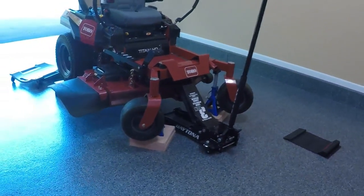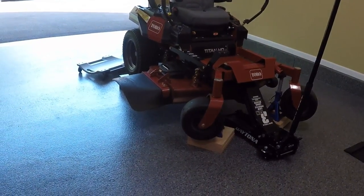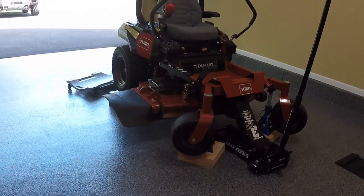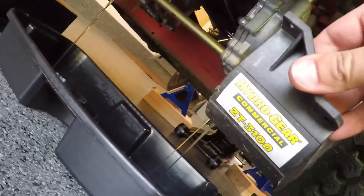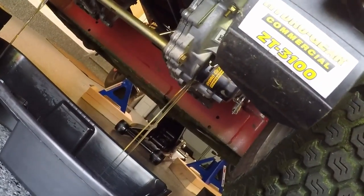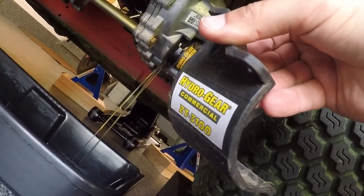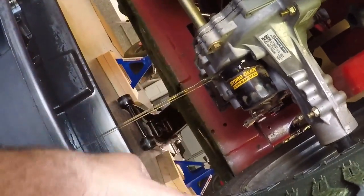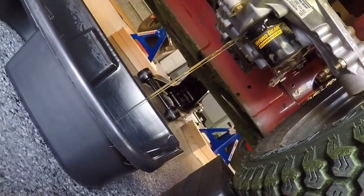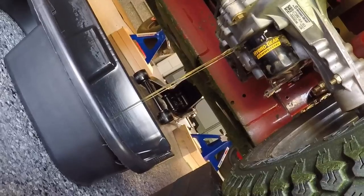Consult the owner's manual before you purchase or order anything, just to make sure you have the right one. These filters fit most of their spin-off style transmissions. Now, I already got everything draining. I took off the filter guards — just three bolts hold them on. If you're not sure what trans you have, typically it'll say it on the filter guard. The transmissions are exposed, and you basically take the filters off the same way you would take off any oil filter on a car — it just spins off. There is no actual oil drain plug; you drain the oil by taking off the filters.